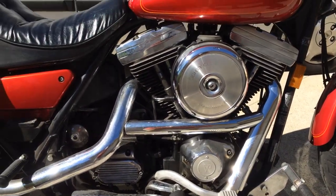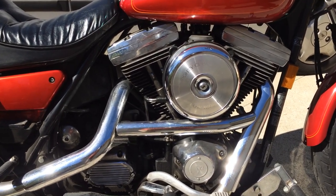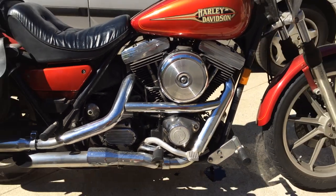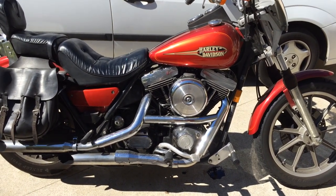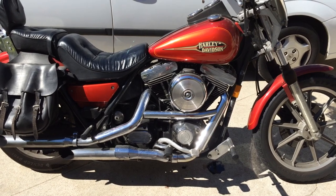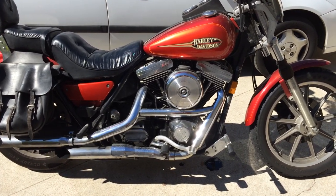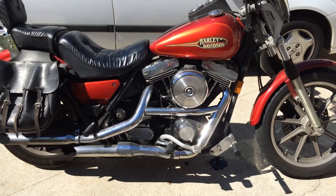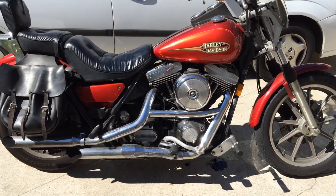Once it's cleaned itself out, you want to check your oil level and top it up. Just make sure you ride your bike once a week or two. Most people who have this problem just live with it — as long as they start their bike up regularly and don't let it sit for a month at a time, it's fine. If it's happening every couple of days, then you have to replace the oil pump. Otherwise, just don't worry about it and go for a ride more often.